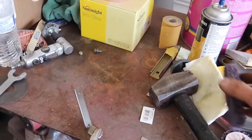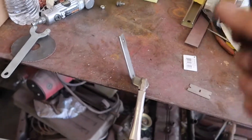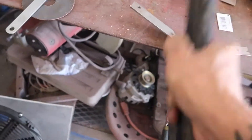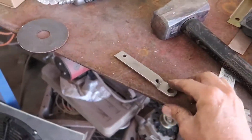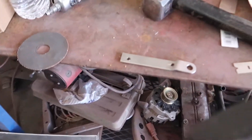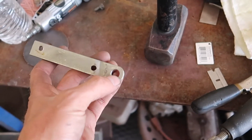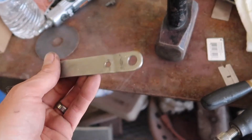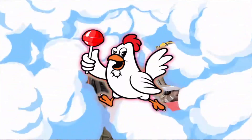So this is what it's boiled down to on my bracket making - we've got to go old school on this thing. Let's see if I can hold on to this camera because I don't have anything to bend this - it's stainless. I got all trigger-happy on this thing and I checked the hole size, which I should have checked before I put all that effort into it. The hole is too small. This is stainless and it's thick and I'm not going to waste a drill bit. So plan number two - I'm going to find some aluminum and make a bracket.